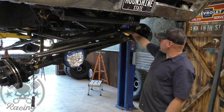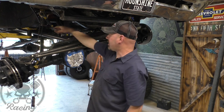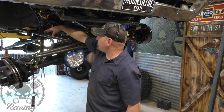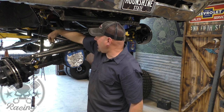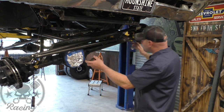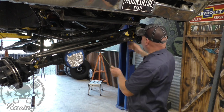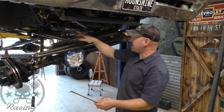What I did is I just put a block in between on the compression side — I'll show you on this side so you can see it. I just put a block in between our tube for our coilover and the pad that's two and a half inches, because that's what a fully collapsed bump stop is, at least these ones. Then I just pull this side up and drop that side down until our block's hitting right in the middle.